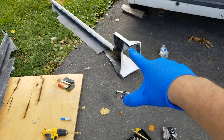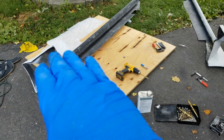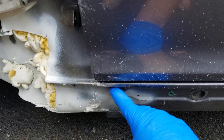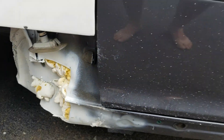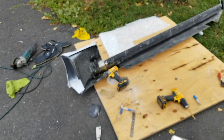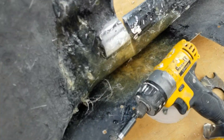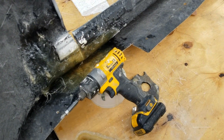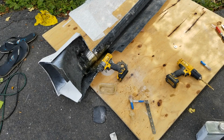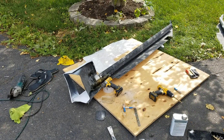I'm super happy with it except one piece is a little bit messed up. This one was also messed up but I already cut it and I'm redoing everything. Basically I thought I made them straight but when I went to mock it back up to the car there was a gap here and here, so I kind of made this piece go crooked — that was my fault but I'm already fixing it. My camera died but I cut it and fixed it with more resin and fiberglass. Once it's done I'm gonna put it on the car and then put the fiberglass bondo on top in the front. It won't crack now because before without the fiberglass in the back it was just cracking. Now since it's not flexible it'll be one solid piece.